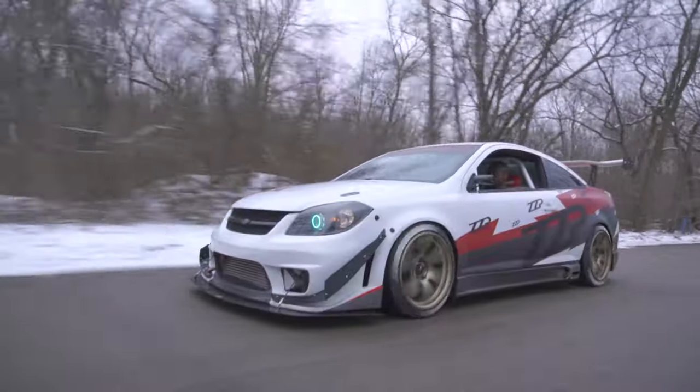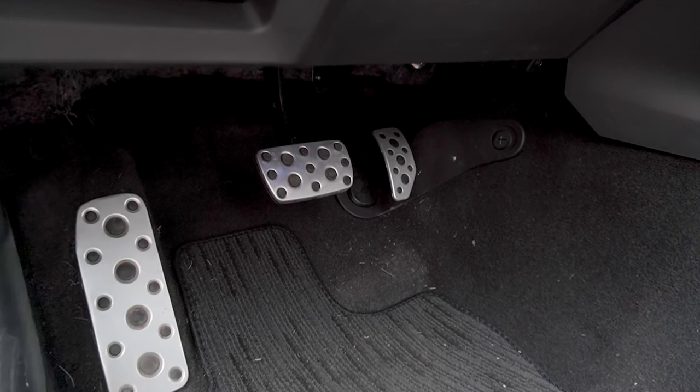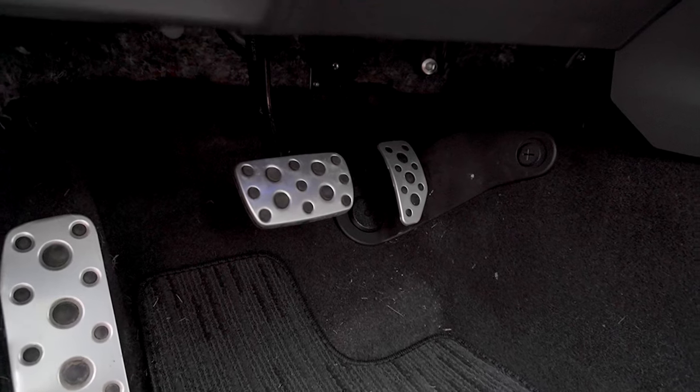Same thing for road coursing actually. Myself, Tyler, Tim — we all road course our vehicles, and even considering modulating the throttle when the car isn't actually at 100% when you're flooring it or anywhere in between, it's basically some made-up number that will not be accurate to where your foot's at. It's really not a very intuitive way to drive your car. If you want to be at full throttle, pin it to the ground, floor it all the way, which we see in a lot of our scans — a lot of you guys don't actually floor your cars. When you're trying to modulate the throttle and know exactly what you can let off and let back into it, it's better to have an accurate pedal feel rather than one that's just turned up to some arbitrary percentage earlier in the pedal. You really want it to be accurate to where your foot's at.